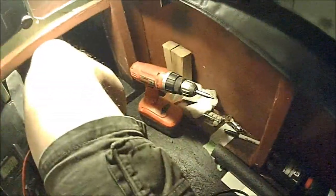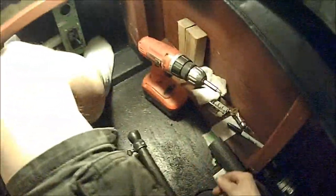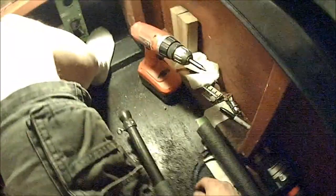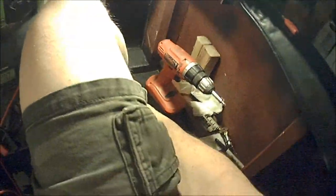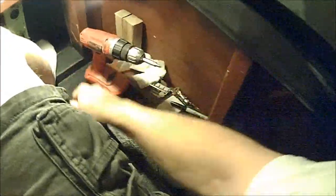Just wait till I get the rest of the throttle stick all hooked up. I still have to hook up the collective, which is going to be mounted down here, down on my left hand side. And I get the flap switch right over here, or at least the flap handle. Basically, it's just like on a Cessna. I seem to like that arrangement, where you just grab onto the stick and pull straight up. And I'll have detents on here for being able to adjust it. But I still have to get the cable hooked up to it and get the potentiometer hooked up, same as the throttle. So, alright.